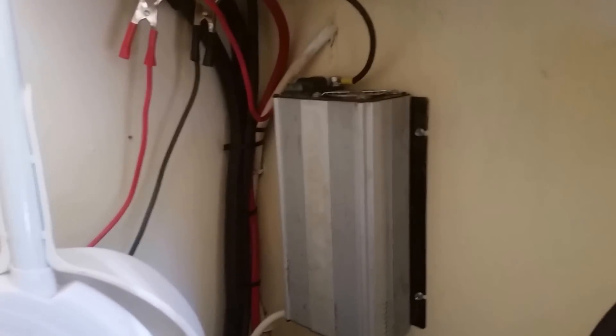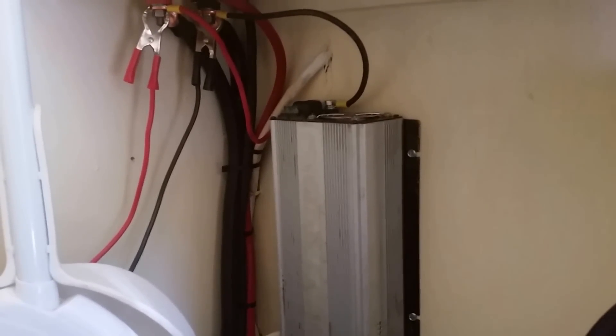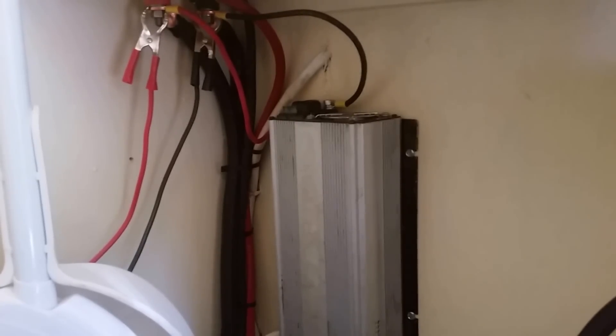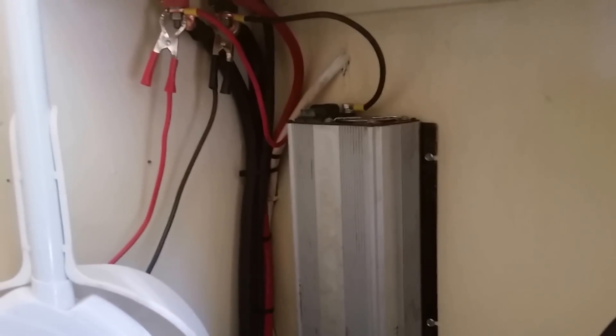In the closet of the small camp trailer I've mounted the inverter. These are pretty inexpensive — a good one you can get off Amazon is called a Power Bright, an 1100-watt modified sine wave. These small 1000-watt AC inverters are able to operate that small chest refrigerator or the little upright refrigerator without any problem. They've been running for over a year with no sign of wear on the refrigerator or the inverters. Last time I checked you could get an 1100-watt Power Bright for $85.